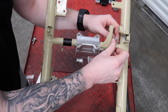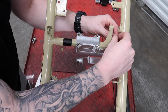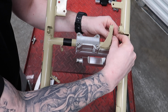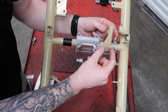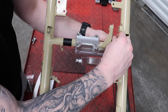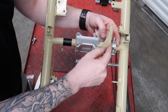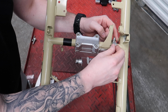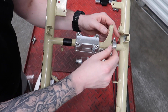Now you'll see when you put the shock arm on, you want to have some room, because the shock arm tab is going to go over the same bar here and right next to this. And sometimes what you may notice is if these factory welds are a little bit thick, or the powder is a little thick, it may put some pressure on it and you'll have to potentially grind down the welds. Or you could open up the C-clamp here a little bit. You don't want to go too much where you can start to hurt the integrity of the product or the frame.